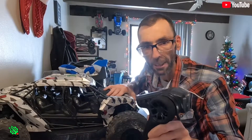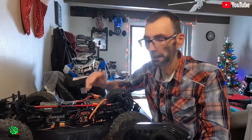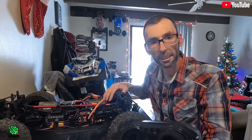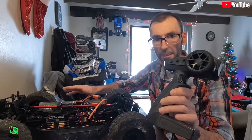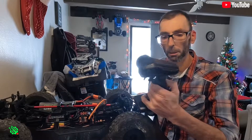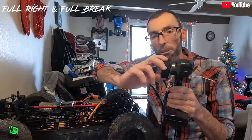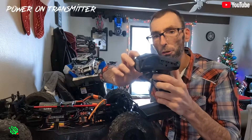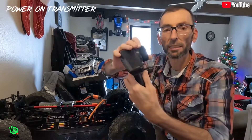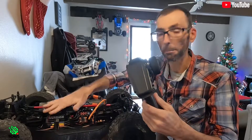Get a battery in it and I'll show you exactly how to set your endpoints. We've got a 4S battery in it - it doesn't have to be anything fancy. Make sure you have good batteries in your controller transmitter. This is going to be a combination of holding the steering wheel full right and holding the trigger full brake as you turn the remote on. That'll cause the light on the front to flash, and once it starts flashing you can let go.